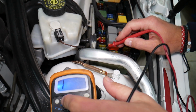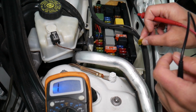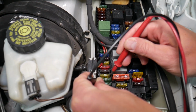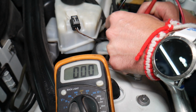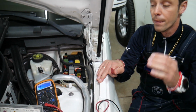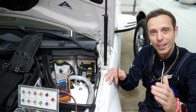Now, some fuses are super hard to see if they're burnt or not. Some of them will be really easily accessible. You can clearly see them, but there will be fuses that are not see-through, fuses that may look like they're not burned, but they're actually burned. And often you can actually even test these fuses without even removing them. But it's very important to know how to test different fuses and relays, and if you want to see how to do that, we're going to put a link to a video in the description below, how to test a fuse, how to test a relay. Always check that. I want to emphasize that enough because it could be a really simple fix.